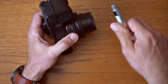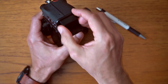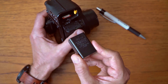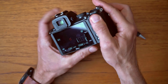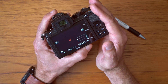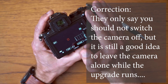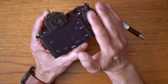Before we start, a little tip if you try to do the upgrade and it fails. Nikon is a little bit risk-averse, so they require that you have a battery that is if not fully charged, then very charged — something around 80% or thereabouts. So if you try to select the firmware upgrade menu item and it fails, it could be because your battery isn't charged enough. Also, Nikon is really cautious stating that you should not touch the camera while the upgrade runs. Have a fully charged battery and don't touch the camera while it upgrades, and you should be good.